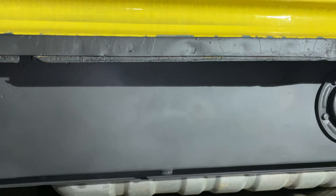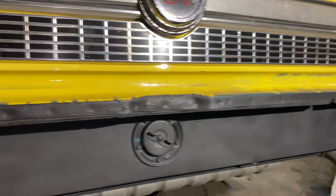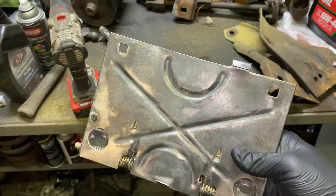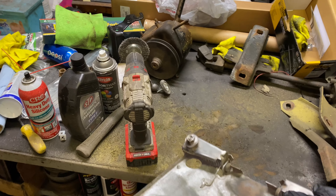It's all cleaned up. All the heavy rust is done, it's smooth. I cleaned this with some isopropyl alcohol — you want something to clean this really good to get any grease, dirt, and foreign materials out of here before you paint. We got it all cleaned up, looking good. I'm gonna give it a coat of paint, then we'll come back after it dries to install the bumper.